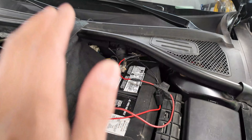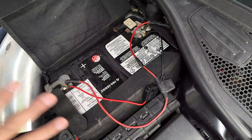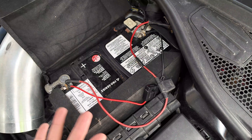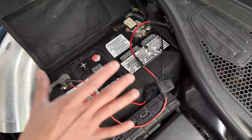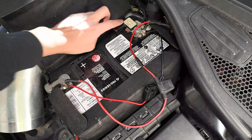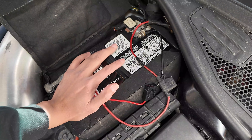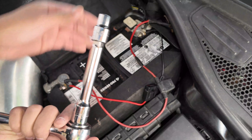If you're looking for more reliability and concerned about your battery dying too quickly, invest in the AGM battery — I highly recommend it. Before we remove the battery, if you're ever unsure about the proper orientation to reinstall it, I always recommend taking a photo so you can refer back to it. As you can see, we have the positive side and the negative side over here. What you always need to do when removing a battery is disconnect the negative side first. These German cars always have special electronics connected to the negative side — there's a module connected right here — so these cars can be very finicky, especially when it comes to electronics. We want to make sure we're removing it in the proper order using a 10mm.